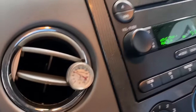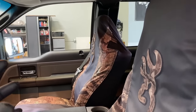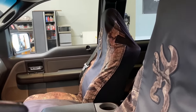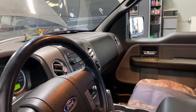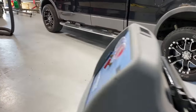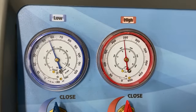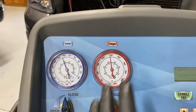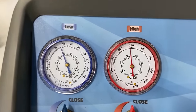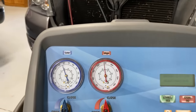It's all going to correlate with our discharge temp inside — we've already pulled the heat load out of the vehicle, it's closed up, and it's still discharging over 60 degrees. You're not going to feel cool from that. So that is all for now — I just want to show you what an overcharged system looks like compared to a properly charged system. Both your low side and high side pressures will be way too high for the ambient conditions you're in, and you're not going to get that cooling effect. Stay cool, guys.